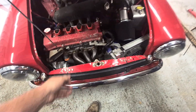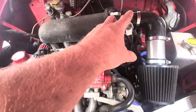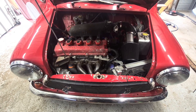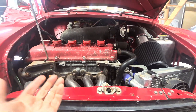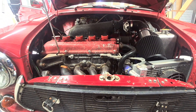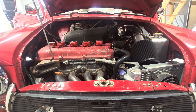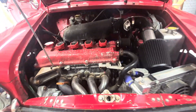We've got it up and running - still nice and cold. It's actually idling half-reasonably. I've had to adjust the idle screw - it's got no idle control valve so I don't think it's going to be horrendous, but if he wants it to feel completely OEM he might want to add one in future. This is at 25 degrees, so it's really not hot, idling okay. The first 20-30 seconds may be a bit rough, but we might be able to open the throttle plate a little bit more. Let's see how it goes when it's warm.